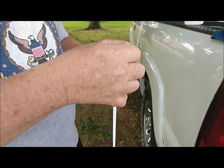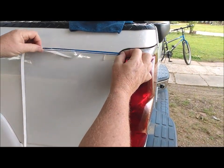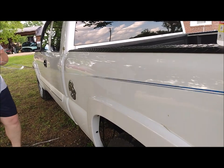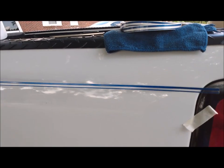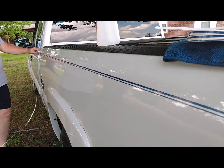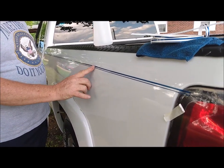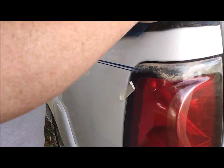I'm going to peel that clear plastic off when I get it on the truck. I'm just kind of eyeballing this to get it straight. That's pretty much where I want it. Then I'm going to pull the whole length out. You want to make sure that you don't stretch the pinstripe — just hold it up there until it's kind of tight, not terribly tight, but you don't want to stretch it. Then just kind of lay it up against the truck. And there you go — you've got a pretty straight pinstripe.